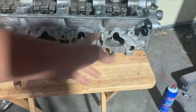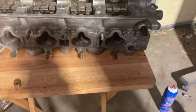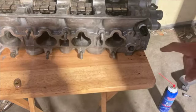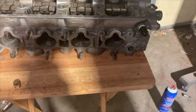Use Teflon tape, it makes a better seal. I cleaned it out before because when I was tapping the other block off, there were metal shavings in there, so clean that out.